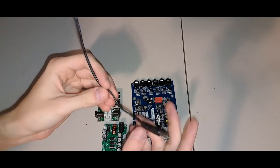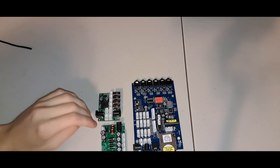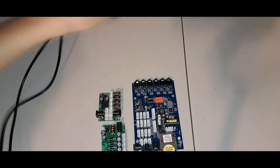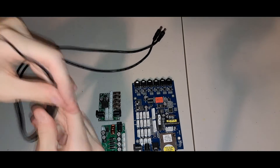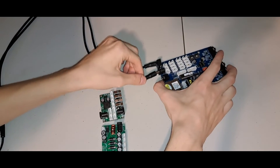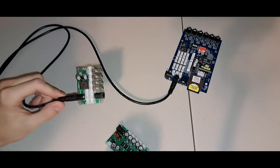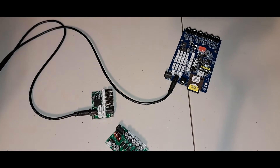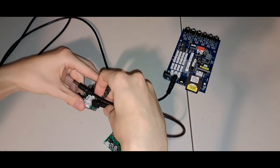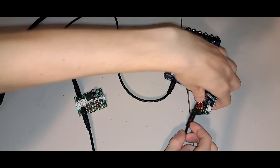This thing was cut right out of the wall, so it just has this power cord that also says DC 12-volt along the wire. We're gonna have the power going into a DC 12-volt splitter — this all came with the electronics. Power comes in, goes into the splitter, one end goes into the main board itself, and the other end goes into the power side of the 12-volt to 5-volt distribution block. Then we have a DC 12-volt barrel jack cable and there we go, we've got our basic little loop.